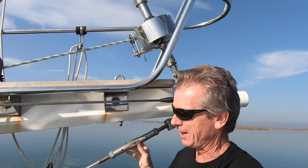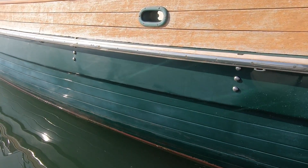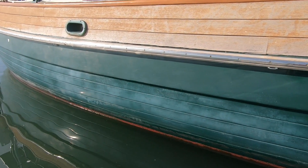This video starts in the autumn of last year with the preparation. If I show you what the problem is — if we look at this side, this is how it should look. I've already had a bit of a go at dockside on this side; it's a bit splashed from the trip down here and it's only had one coat of polish. Coming around to the other side, the bow isn't too bad but further back you'll see how much blooming there is. It makes the darker colors — you can see it here — go white, so it shows up on dark colors pretty badly. That's just the oxidization of that top layer and you've got to get through all that.